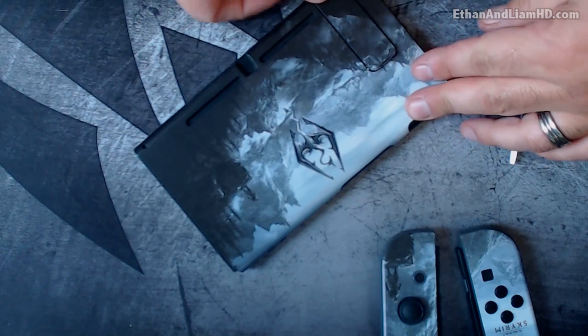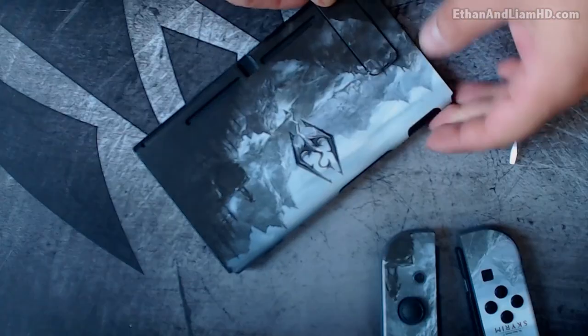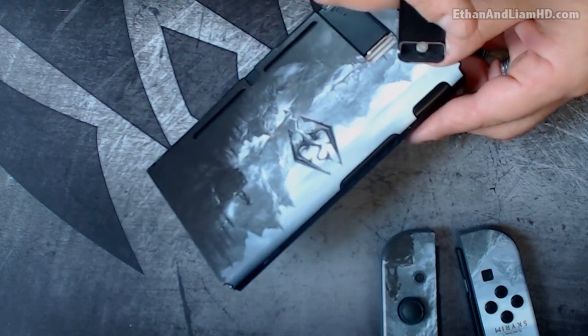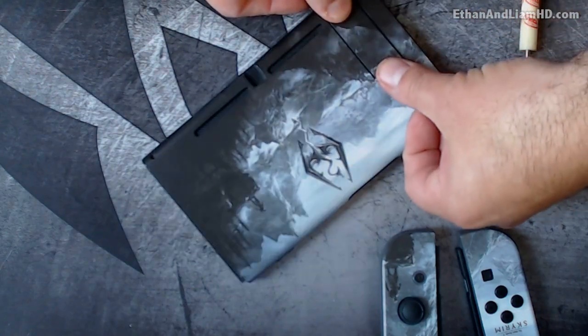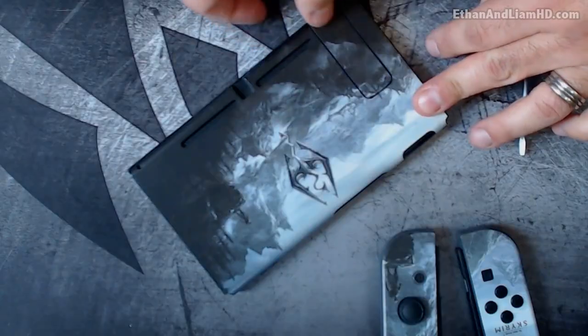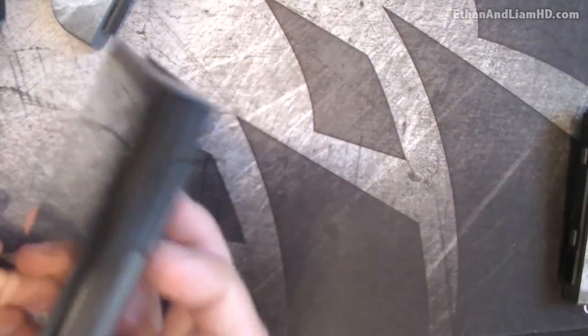So first we're gonna place this guy back on. It's really really easy - all you have to do is set this down flat and then you'll have just that piece protruding where the little prongs are. You see the two little prongs right there? You push those down, one side and then the other, and that's it - fixed. You have a kickstand, it's working again.